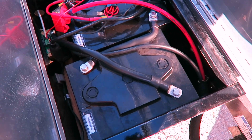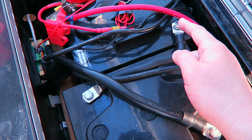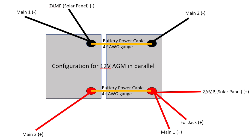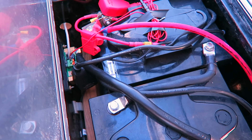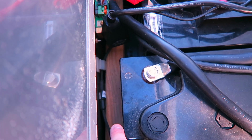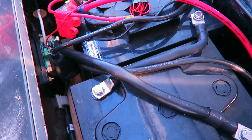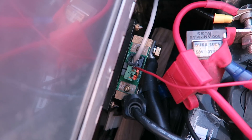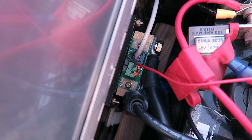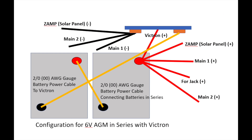Let's take a look inside at the batteries. You can tell we have the batteries in series, not in parallel. If they were in parallel, you'd have wiring running negative-to-negative and positive-to-positive. This is how we made it work — it fits. I ended up putting in a piece of wood below just to prevent slippage of the batteries within the box, because they are just shy of the sides and I didn't want any extra pressure being pulled on the cables. I installed the battery monitoring system right here — I actually had to drill from the outside in to get it installed, but given the very small workspace, that was the best placement I could find.